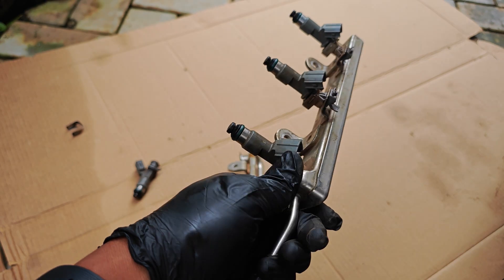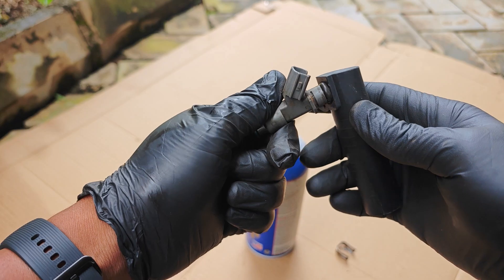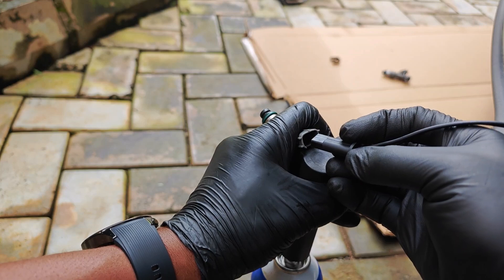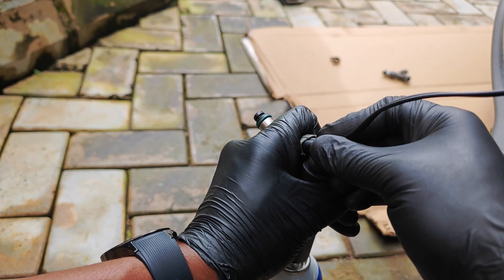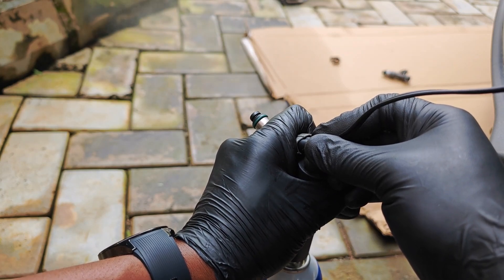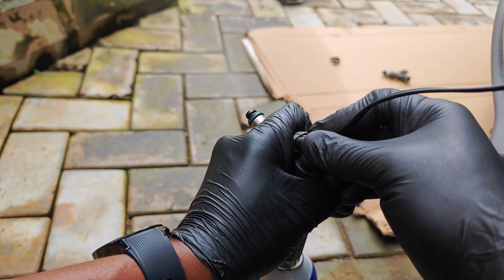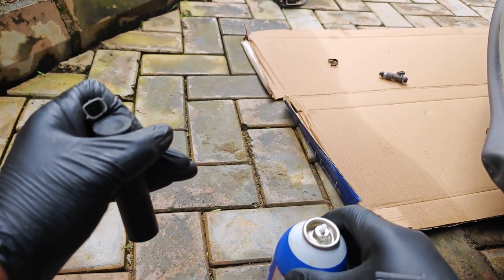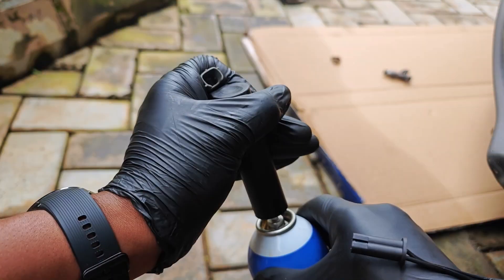For the purpose of this demo I'll take off another injector that works. For actual testing with solvent, I put the good injector into the adapter which then goes onto a can of carb cleaner. You have to hold the injector very tight to the adapter and don't push down too hard on the can. I depress it just a bit, lift the can slightly, and give the injector time to spray and bleed out all the pressure before disconnecting. If you're too aggressive something messy can happen, so wear eye protection.